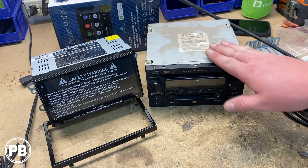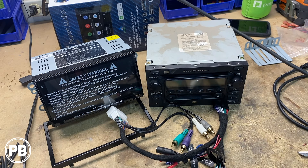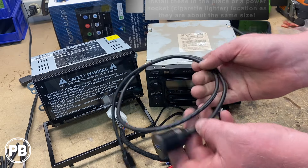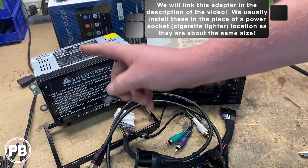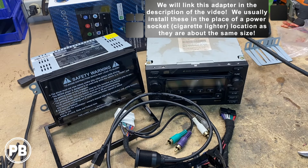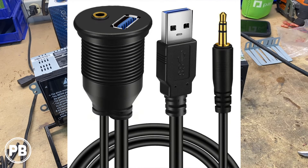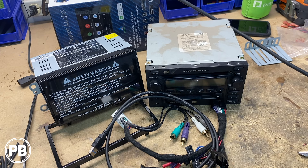We're done with our factory radio and done with our wiring harness, so it's a great time to head to the car and start getting everything installed. One quick note before we do: if you find that your USB on the back of the radio is on the back and not on the front, we're going to be installing one of these flush mount adapters. This transfers the USB to a location that we see fit, and this end plugs into the USB on the back of the radio. You can get these in all different configurations — dual USBs, USBs with aux, USBs with HDMI, HDMI with aux — it really depends on your configuration and the radio inputs.